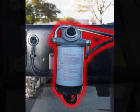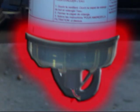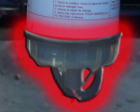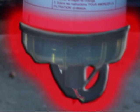Further down the frame rail you'll notice a heated fuel filter. It features a clear sediment bowl which can collect heavy particles from the fuel supply as well as any moisture from condensation that may collect in the fuel tank. Notice the attention to detail with the in-frame grommets used in UD trucks — these grommets eliminate any direct contact between wiring and the frame in order to prevent friction wear, increasing long-term durability.